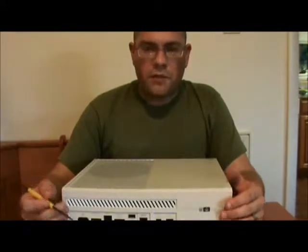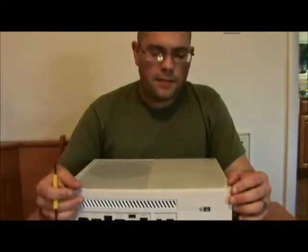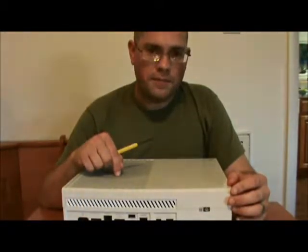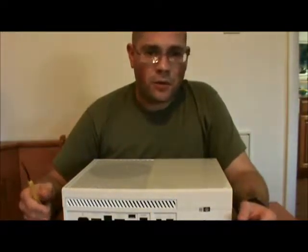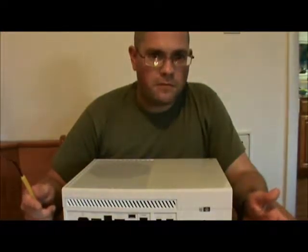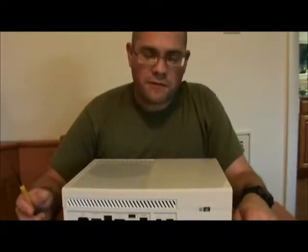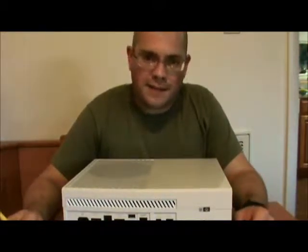What are you going to need to do other than opening this baby up, which we're about to do, and then unlimiting the fan? The other thing you're going to need to do is set the system to power save mode. If you don't do that, then when you turn off your system, it's still going to be howling all the time, because quick boot mode, it's not actually off. It's still on, producing heat and killing itself. It's part of Microsoft's designed obsolescence, so that you can then turn around and buy an Xbox One S.